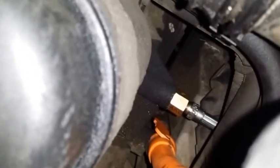So there's actually, this is your oil filter right there. That thing goes down, and down there is a sending unit. It just reads to see if there's oil or not. So your car doesn't actually read pressure. You can't access a block using VCDS. You can't do that to see how much pressure there is. You actually have to physically hook up a little hose and then put a gauge on it and see how much PSI it is.